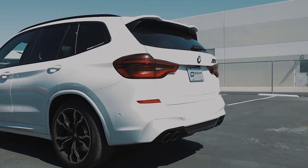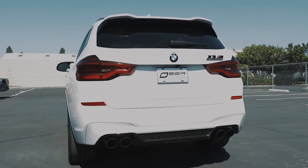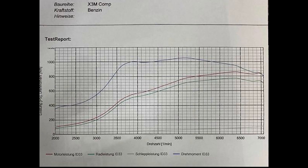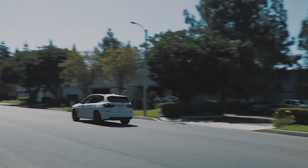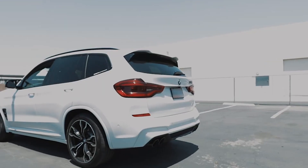The new X3M and X4M has the same engine as the M3 and M4 — the car is just a bit heavier but the engine on the inside is the same. Now this guy made 861hp and 1050Nm of torque with upgraded turbos, a tune, and an exhaust system — no meth, only ethanol, and it's on stock fueling. That's impressive. Reaching those kinds of numbers with other 6-cylinders you'd need a parts list longer than the Great Wall of China.